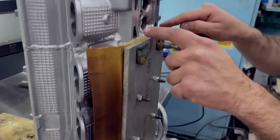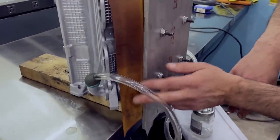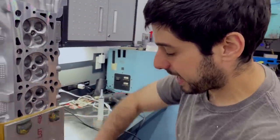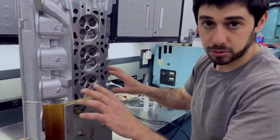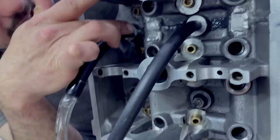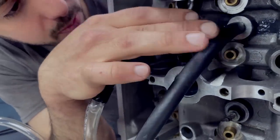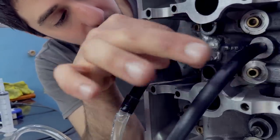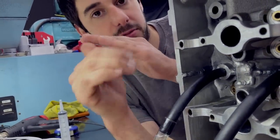The plan is to put the epoxy in on one side blocked off with rubber, which will seal half of the head. We'll be pulling vacuum from one half of the head as well as the two bolt holes. We epoxied and JB Welded the top of the seam to give us a ceiling there, and we're actually vacuuming on two of the holes where the cut is. That should help draw the epoxy through the gap between the two cylinder heads and really seal up everything we can.